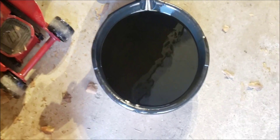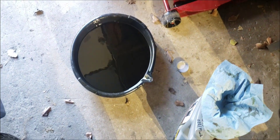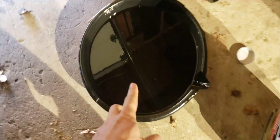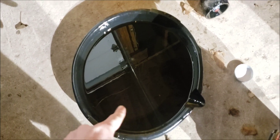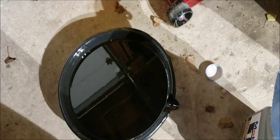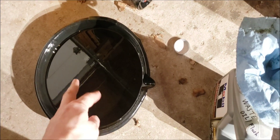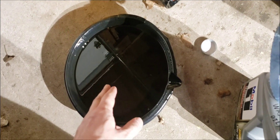I'm going to pour the drained oil into the waste container. This oil was basically brand new just a little while ago and after running that engine flush, look how dirty it is — it looks like it already has 5,000 miles on it. I'm going to filter it through some paper to check for any metal particles or debris. I also need to find the washer for my oil drain plug to see if I can reuse it — it's a hard plastic one.